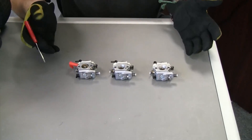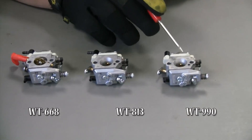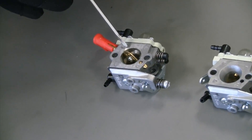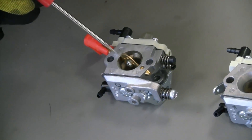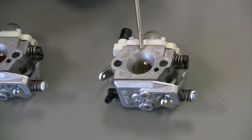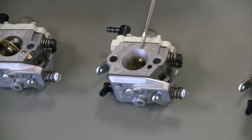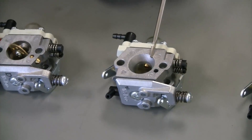I've got three carburetors here: a WT668, a WT813, and a WT990. The WT668 probably looks familiar — it's the carb you get with any stock car, low-size HBIs, MCDs, FGs, Rampages, and so forth. The WT990 is the carburetor you receive when you buy engines from us. The 813 is another common carburetor we run into; it has an accelerator pump so it's a little trickier to tune.